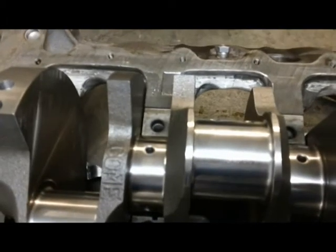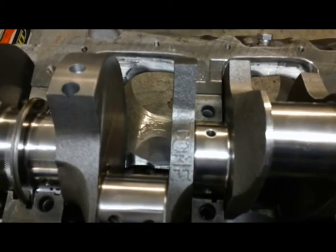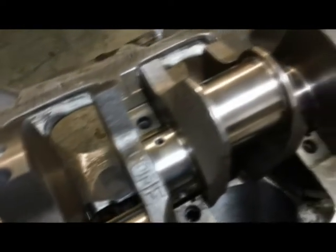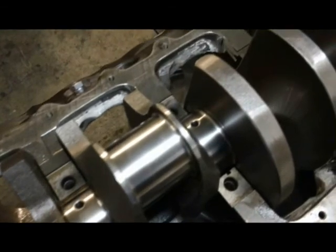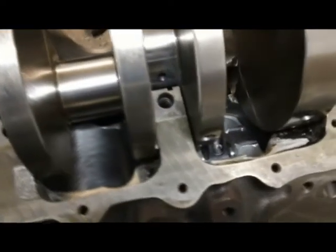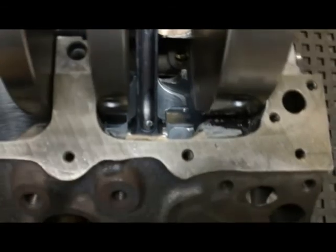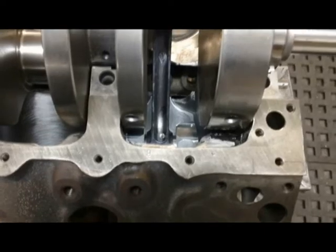You will not hit water into the water core area. The clearance we normally look for is about 50 to 60 thou, or one and a half millimetres. Check the crank counterweights as well, because sometimes in this area — front and rear counterweights — they get very close. That's it.